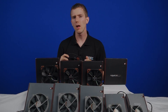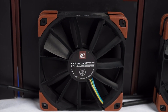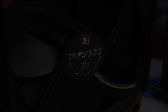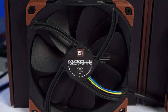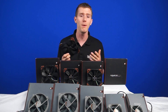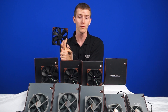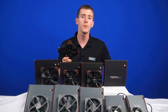There are only a couple of models available: you can get an NF-F12 or an NF-A14, and depending on which of those fans you're looking at, you can get them in 2,000 or 3,000 RPM versions, and with either IP52 or IP67 dust and water resistance. They are more expensive than the regular Noctua fans, but you do get a couple of improvements — they run at higher RPM if you're looking for more extreme performance.